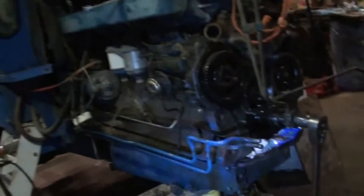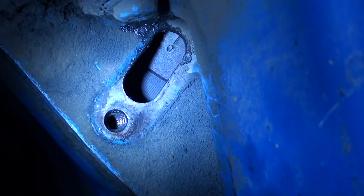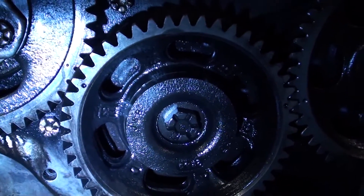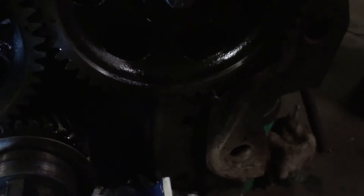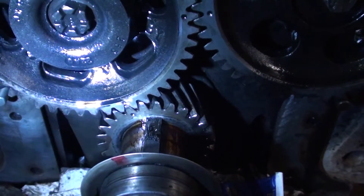Right now it is set at zero degrees — and the block heater's in the way, but I hope you can see that's zero degrees. That's what the line is about, in the center of that slot. Now on the injection gear, two marks are lined up where the center punches are in the same tooth. The auxiliary drive and idler gear are lined up also down here, which I'll slide this back out again — that is lined up.